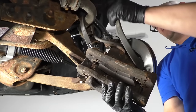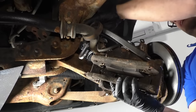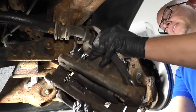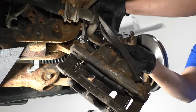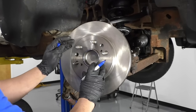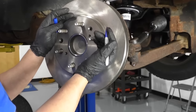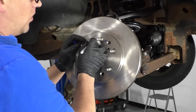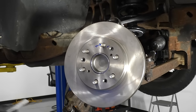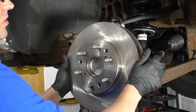I'm going to wrap this up a little bit higher. Wrap this a couple times. Position that out of the way. Make sure that hose is nice and loose. This is a newer rotor and a newer hub setup. If you had an older rotor and older hub and the rotor is loose, you don't actually have to take the rotor off for this, but it's just easier to take it off. I'm just going to mark where the rotor went because I want to put it in the same spot when I go to put it back together, just in case there's any variation in the hub to rotor. You want it to ride the same as when you took it apart.